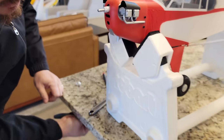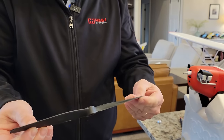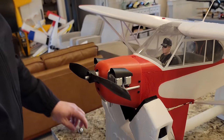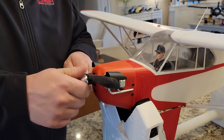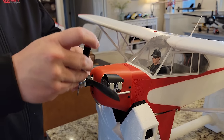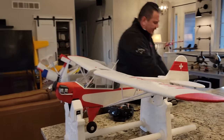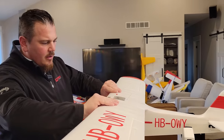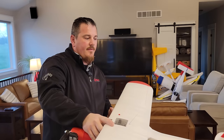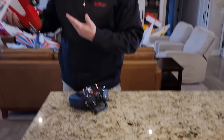I took the sharp edge off — I can do that with a sanding block, a sanding wheel, or a grinder. The only reason I did that is because it chipped when we hit the dirt. Now we should be able to put that back on, secure it, and do a quick test on vibration. If it's terrible we might need to take a little bit more off one side or the other. I love the way it looks when it's flying — it just doesn't quite do what I want. Throttle cut is on.